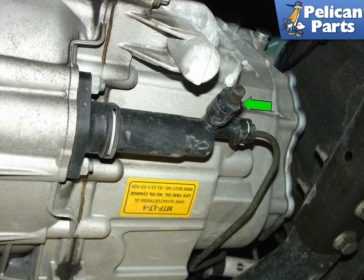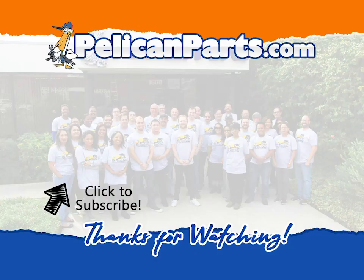This image illustrates the clutch slave cylinder on the later R55, R56 and R57 models. The procedure for changing the cylinder is the same as the R50, R52 and R53 cars. The only difference is that the bleeder valve on the cylinder is a plastic valve that is much easier to open and close, as shown by the green arrow. Thank you for watching — be sure to subscribe to our channel and check out another video in this series.